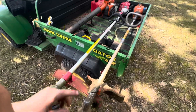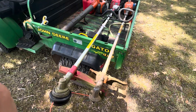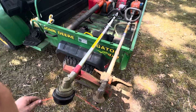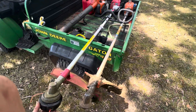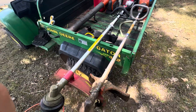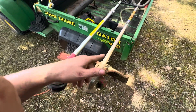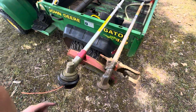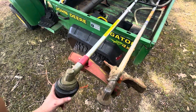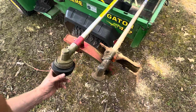It used to last five or six years, but now it's done. The primer bulb was cracked. All I need to do is put a new primer bulb in and replace it with a new cable, and it'll be ready to go. I'll get another one of these heads for this weed trimmer, but I'm not sure they still make these heads for these trimmers anymore. If they still make these heads, let me know in the comments — I would appreciate your answers.